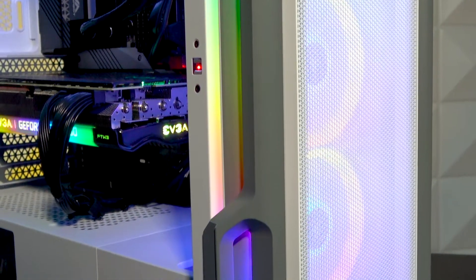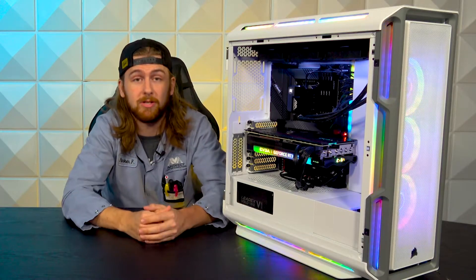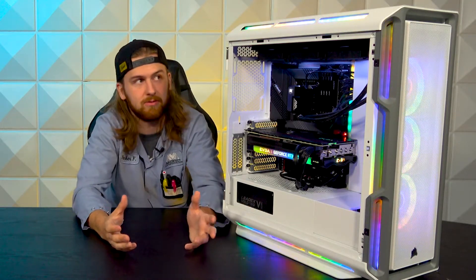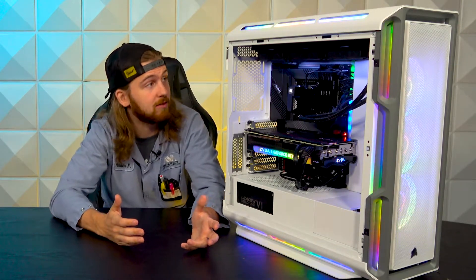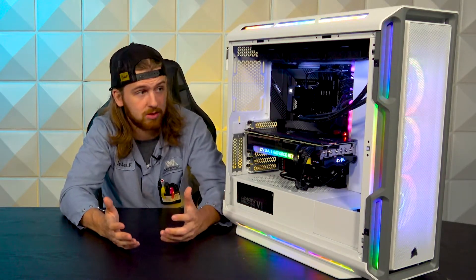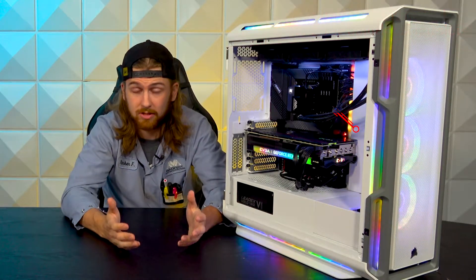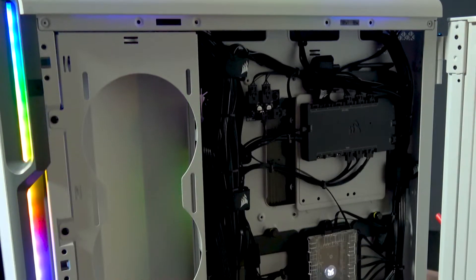As for fan slots, it's got quite a few. For such a large case it's great to see. You can see here we have the 120mm fan slot in the back, a triple 120 in the top, so you can fit a whole 360 rad — as you can see here — with a lot of space between your motherboard. The double stack radiator we've got in it right now fits pretty comfortably with a little space to spare. The front also fits a 360mm — triple 120 as well as triple 140. On the side of the motherboard tray it also fits a triple 120, so it's super nice to see lots of options for where you can put fans.